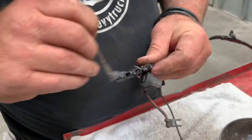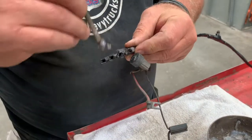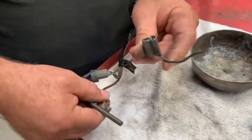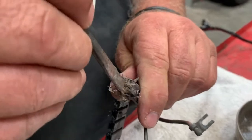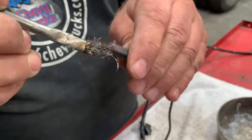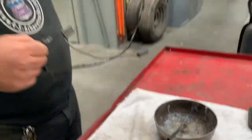In some cases this plug has never had any lubrication on it at all, so I put a little bit on it. This plug here goes to the horn relay — put a little in there, it'll cut down the corrosion and moisture in the plug. This one actually plugs into the horn. This truck doesn't have a horn on it currently, but it's going to have one because we're going to pull one from inventory. So let's put a little bit of dielectric in there, and this thing's ready to install on the truck.